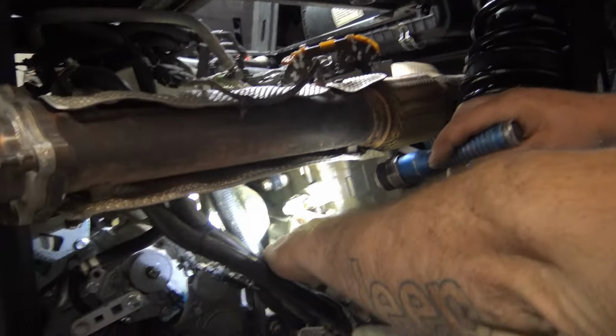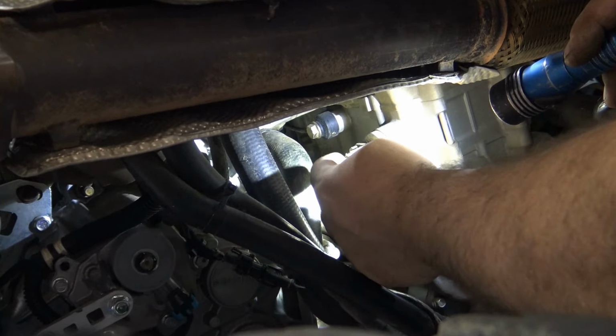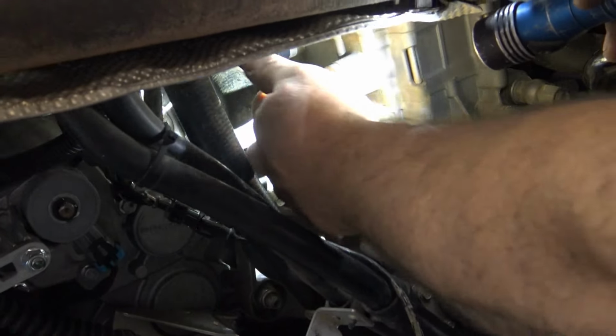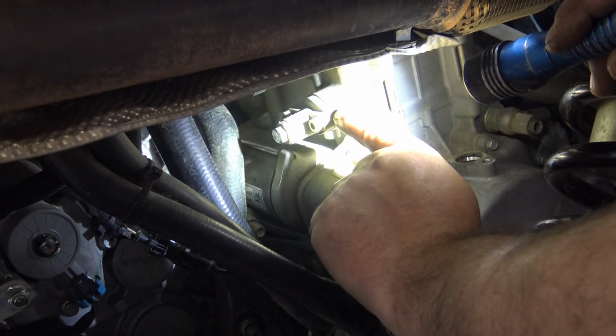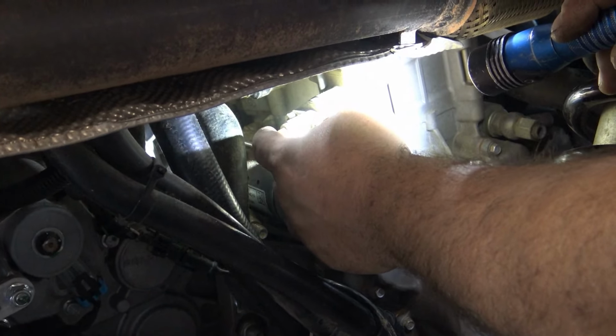This is your timing chain tensioner right here. Yep. So this main bolt's got a spring in it. You don't have to pull that out. So basically, you're just going to pull this bolt and this bolt. There is a gasket here, so you want to be careful to try to save that, because most of the time you don't get another one.